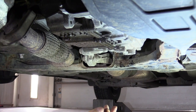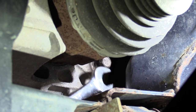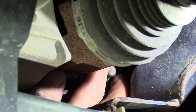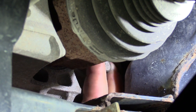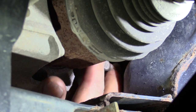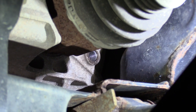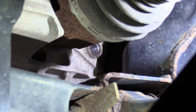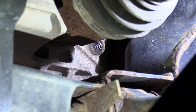We're going to check the temp here and see how we're coming. We've got a 7/16ths wrench — that's the size of the head on that plug, the check plug. We've got it up to 180 degrees and we're going to take this plug out. Be careful, that fluid's going to be hot. We have none running out, so it looks like it was a little bit low.